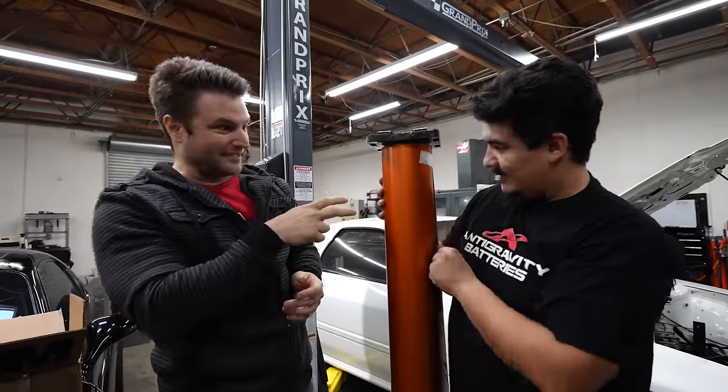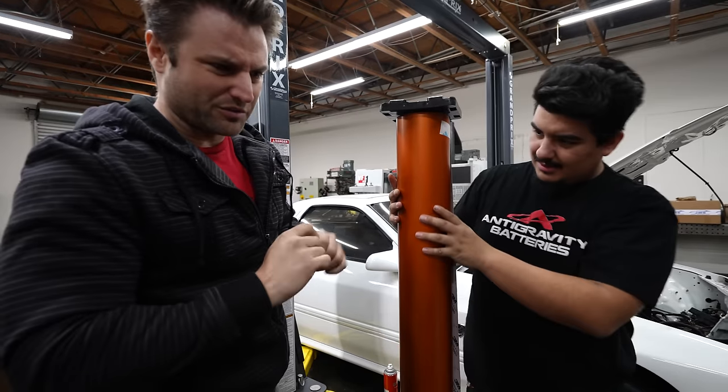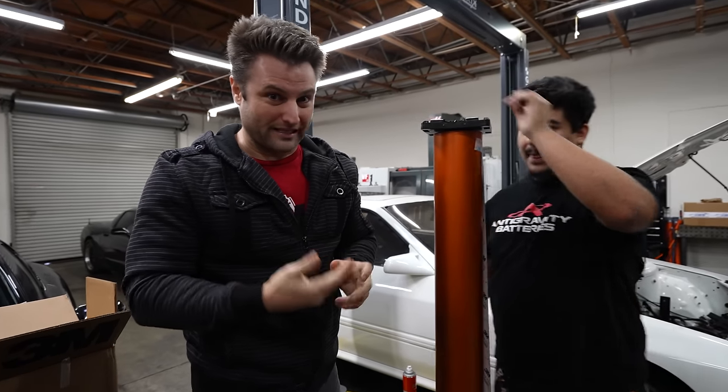We're going to borrow back into my old past of automotive detailing and PPF wrapping. We did a lot of vinyl over our time. The 2080 series is really nice because it's like the 1080 series — it has those little channels in the background so it makes it look really good getting all the air out. At the end of the day, his car has a lot of clear coat damage, so we're actually going to do a full/half-ass way of doing it: taking a dual action sander and knocking down the clear coat, making it all smooth.